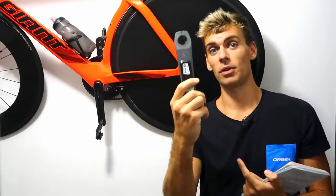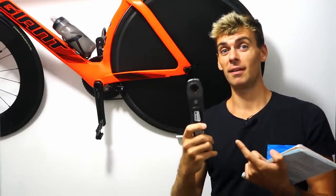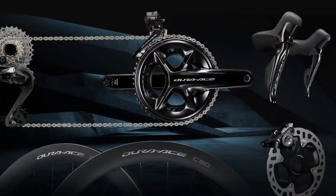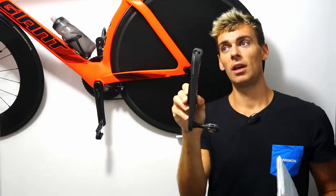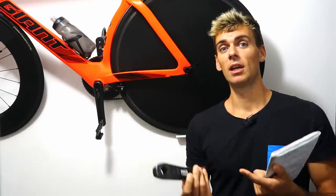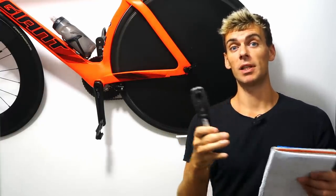If you're looking for a Shimano crank power meter, get a single-sided one on the non-drive side — they tend to work pretty well, whether it's Stages or 4iiii. Shimano themselves have never been able to instrument dual-sided power meters well on their own crank because they're not designed to be torque transducers in the first place. On these new Ultegra and Dura-Ace cranks, down the centre line the crank is almost perfectly symmetrical. So any parasitic bending strains from axial loads, twisting, or offset pedal loads — the strain gauges have a much better chance of cancelling them. That's why we're seeing more regular, symmetrical geometries on the new cranks versus the asymmetry of the old ones.